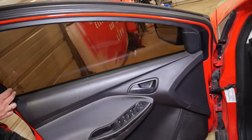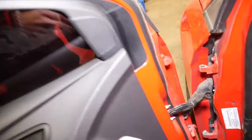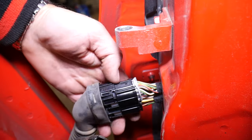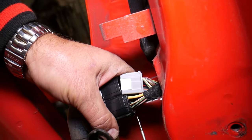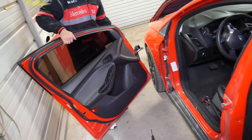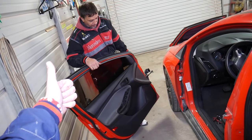Now we're going to grab the door gently and lift it up. While it's like that, I'm going to disconnect the wiring harness located right there — let me get a small screwdriver. We need to press in here — one is out. You may have a different design depending on your vehicle. Now if we grab the door, it's coming out just like that — the door is out of the car! Installing it is practically in reverse order. Hopefully the video was helpful — thank you for watching, please subscribe for more videos, and see you next time.